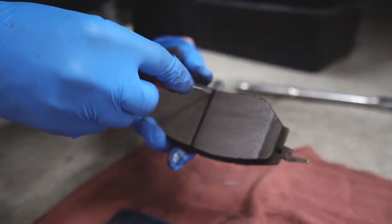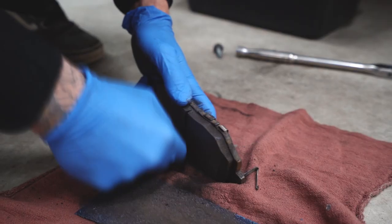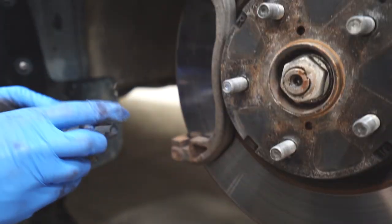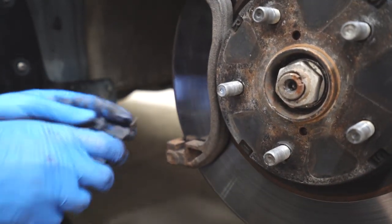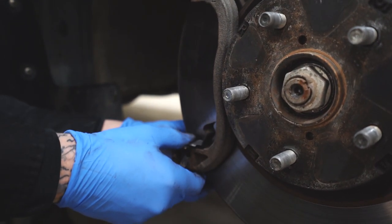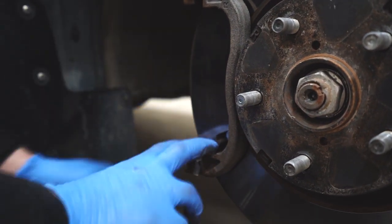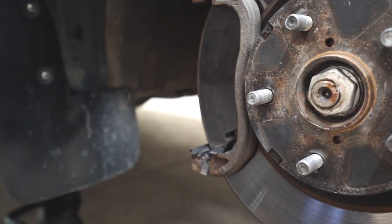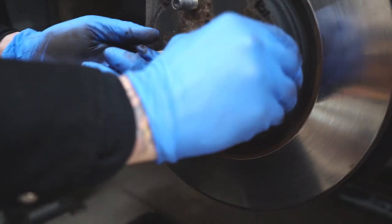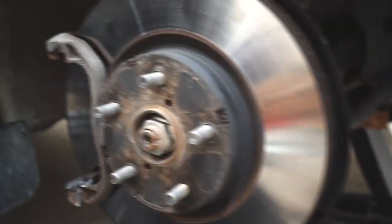Here's a little before and after — some brake dust will build up so clear that off. This one is cleaned and lubricated on both sides. Pop it back in — it's better to use two fingers on both sides to push it down — and always rotate the rotor to see if you got any lubrication on the rotor in the process.